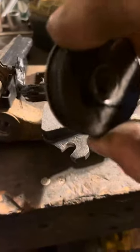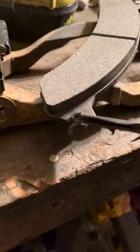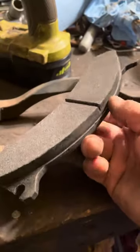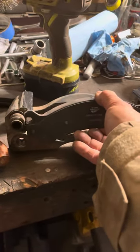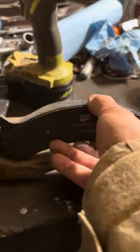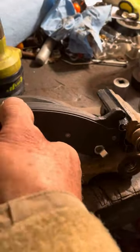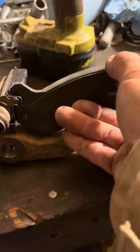Get a nice little amount on there and get some on each one of your pieces in here. Don't get it on the pads. When you slide your pads on here they should operate nice — see, that slides back and forth, that's what you want. You don't want that thing hanging up on you because you'll get uneven wear. Make sure those are slideable and hit all your metal surfaces.